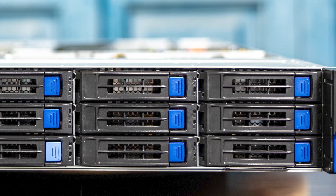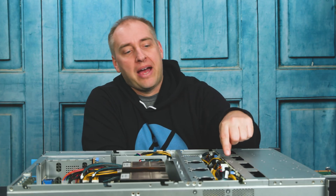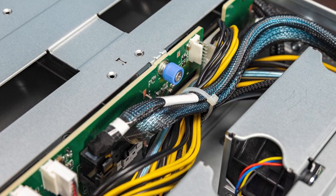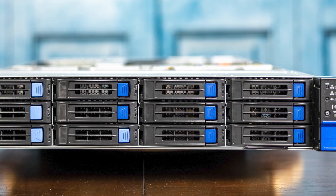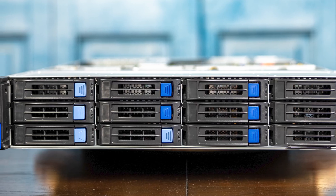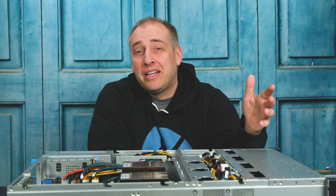There are a total of 12 three-and-a-half-inch bays on the front of the chassis. What Tyan does with these bays is something really interesting — there's actually a removable drive backplane right here. That gives Tyan the ability to use different storage configurations, with just these little blue thumb screws to take the backplane on and off, which is really serviceable and makes it easy to customize or service later. Each of those 12 bays can take a traditional SATA hard drive, and the system is set up to service those 12 SATA bays without using a SAS HBA or RAID controller — you can just run RAID off the AMD CPUs, saving a couple hundred dollars versus buying an HBA.